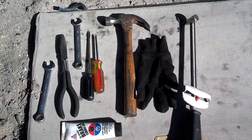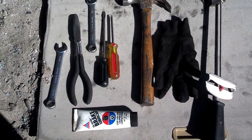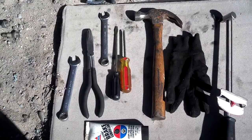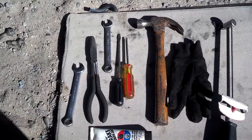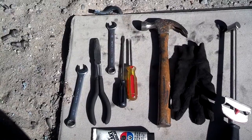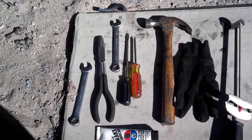These are the tools I use to do the rear brakes: grease, Phillips screwdriver, regular screwdriver, C-clamp, hammer, needle-nose pliers, 14 and 15 box-end wrenches, pair of gloves, torque wrench, and of course brake parts cleaner. Then if you're going to take that rotor off, you'll need a deep 10-millimeter socket.